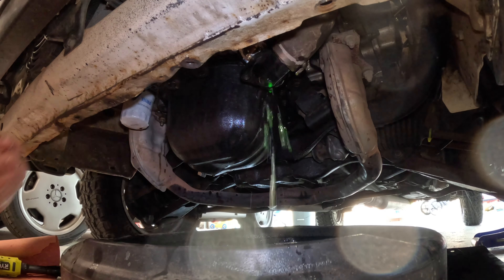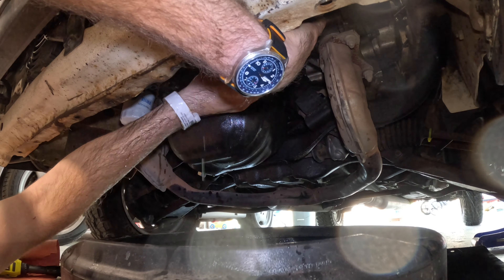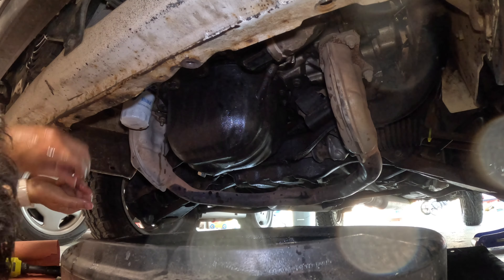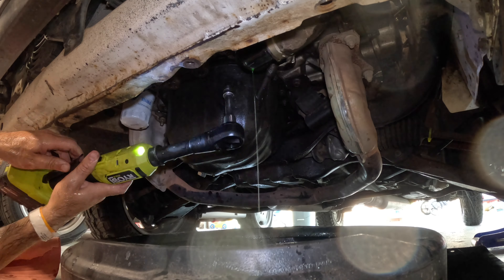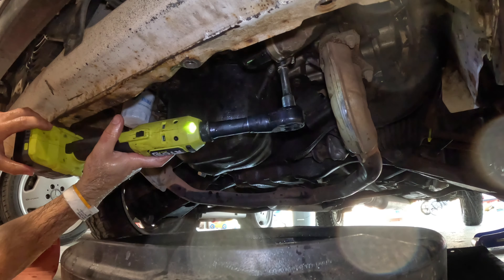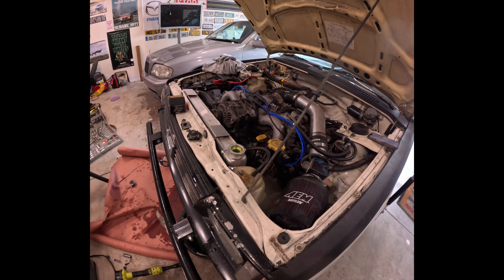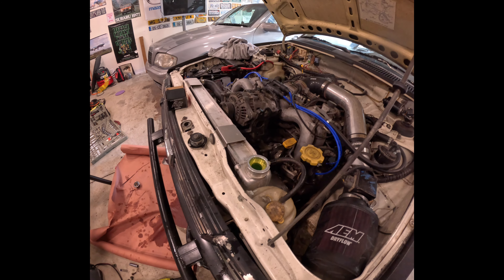However, I monkeyed with it a couple of times to make sure it was seated properly, so I ended up losing a sizable amount of coolant. Would I still do this DIY? Yes, absolutely. Was it fun? No. Am I irritated that I had to recycle the coolant and figure out where you can even do that in the middle of the valley of Oregon? Yes. Is it still in my garage? Yes. Am I still going to properly recycle it? Yes — because I'm an Oregonian and that's what I do. And when you're done, please remember to burp your cooling system.